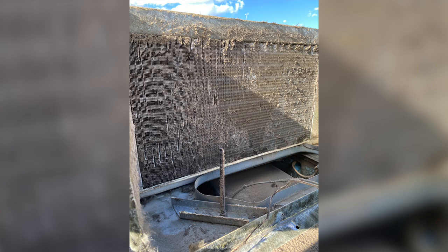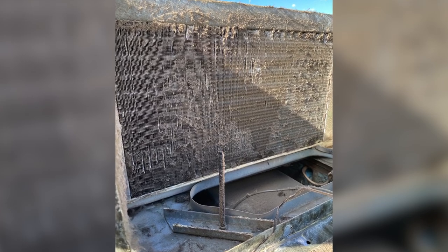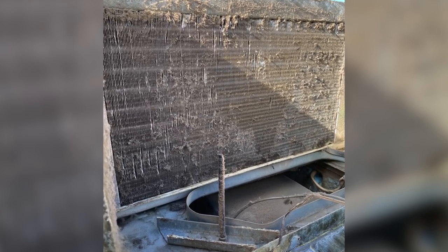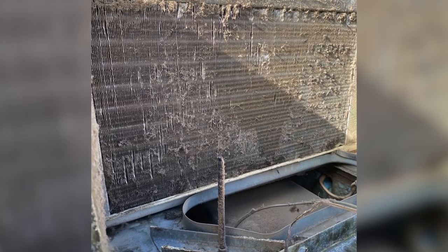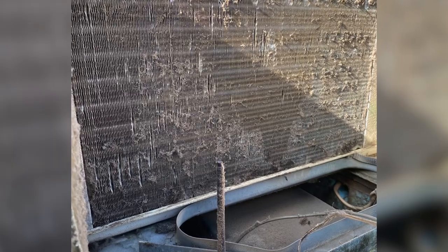After about five minutes of scraping, it was noticeably cleaner but not 100%. I'd recommend getting evaporator cleaner — a foam cleaner sold at any auto store — and spraying down the evaporator to get all that stuff off nice and clean. I didn't have time to do it fully this visit, but I'll be going back up to do that. Also, I'd recommend using a plastic scraper rather than a screwdriver, because the fins are really, really fragile and a screwdriver can bend them.